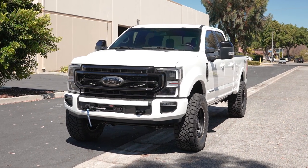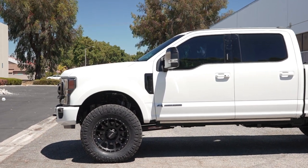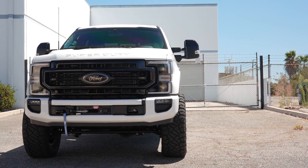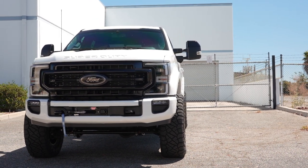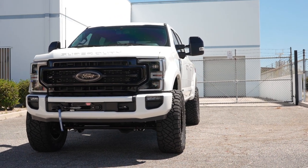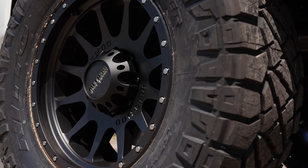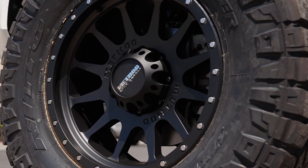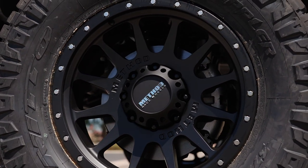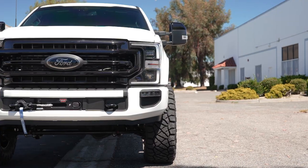For those of you who are really keen observers, you will notice that this wheel and tire combination is completely out of the recommended wheelhouse. With a lot of trimming, we were able to make this truck clear in 90% of street applications. If you were to do extremely heavy off-roading, you will still get contact. However, it is one of those things — trimming versus look versus your personal desires. We typically do recommend more of a nine-inch wide wheel with a little more conservative backspacing.